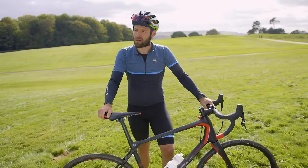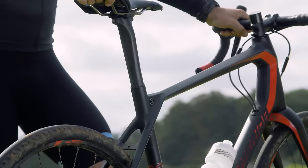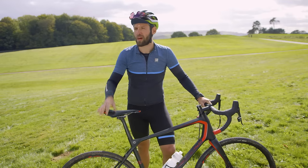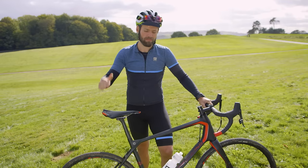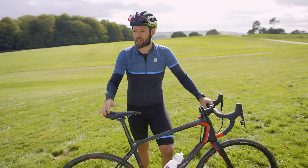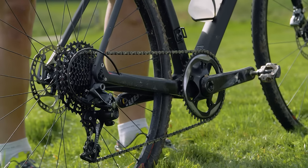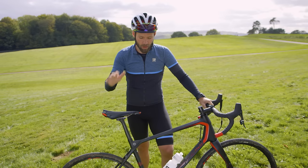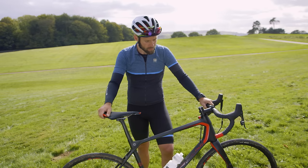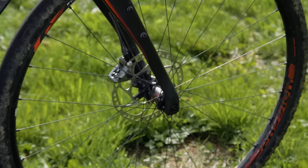That's not the main purpose of the bike, but you can still join a group ride with friends riding road bikes at the weekend. The bike is perfectly capable of managing all of that. And if you say you want to go on a longer bike packing trip with a little more gear, you can go down to a smaller chainring — say a 40-tooth — go reasonably fast and have more versatility on the climbs, which you can't do on a standard road setup.